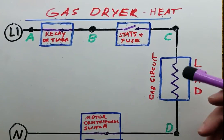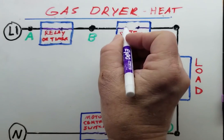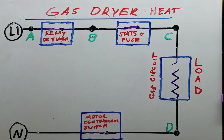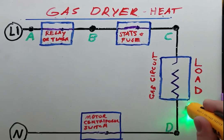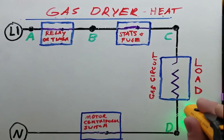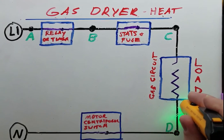Now let's look at the scenario where the load itself is bad in the gas circuit. We'll close the thermal fuse circuit and say we've got a break in the gas circuit resistor — something's going on with your gas circuit, maybe your igniter is open or your flame sensor is open. We've got our 120 volts there, got it there where it should go, got it there — but we don't have it here. So this means either the centrifugal switch is open, or there's something wrong with the gas circuit because the gas is not igniting and the igniter is not glowing. Centrifugal switches don't go bad that often, so we can probably surmise there's something wrong with the gas circuit.